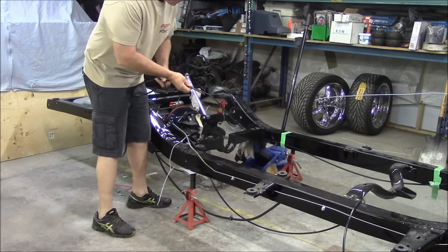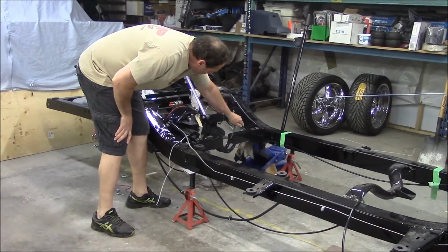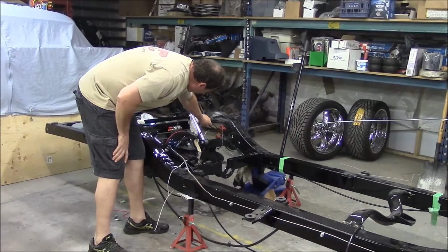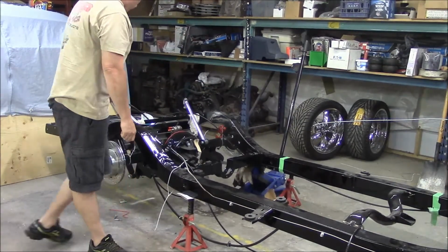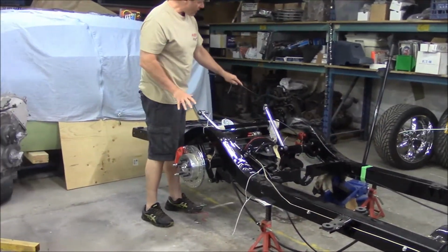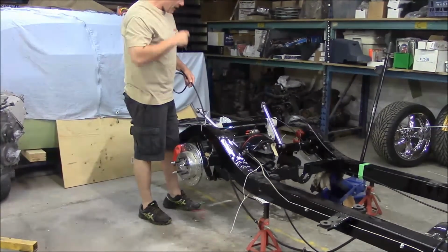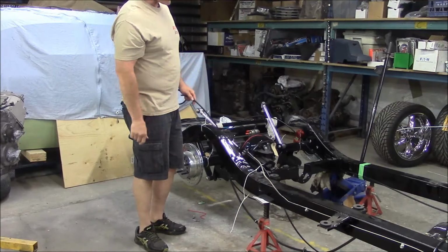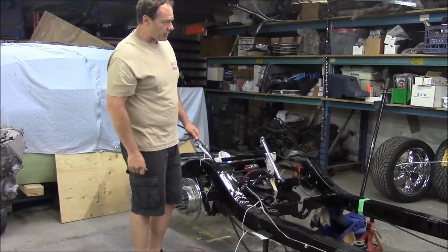I actually took the time, these brackets here actually went right down to the bottom of the frame. So I've shaved those off there and there. I had to actually move this bracket earlier so that I had a nice bit of room to go up and over this arced portion. We actually sectioned it in here just to bring the car down a lot lower, so we lost a lot of that room in there that would allow us to run all of our lines and stuff. So just the challenges that you go through. I thought I was done and I had this shiny frame and everything, and when you start actually working on it and doing these things, you realize that you got to make some changes to it.